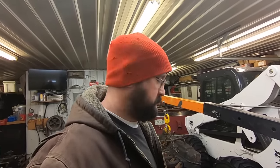The other thing, when you pressure wash, I usually don't like to pressure wash an engine that I'm not going to put in for quite a while, because usually some way, through the carburetor, through the spark plugs, whatever, you get some water in there and your cylinders get all rusty. So this thing, we're going to have it whammied together in no time. So let's get this done, because we got about an hour of daylight. All right, here we go.